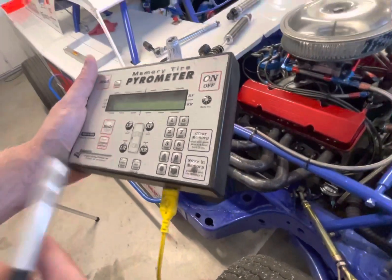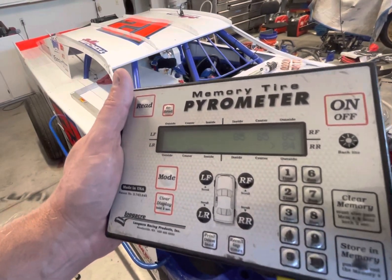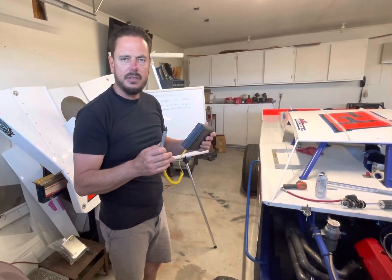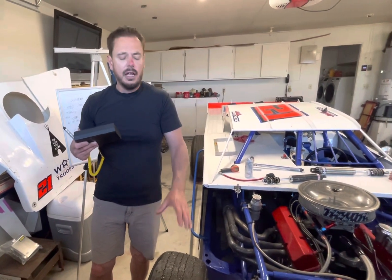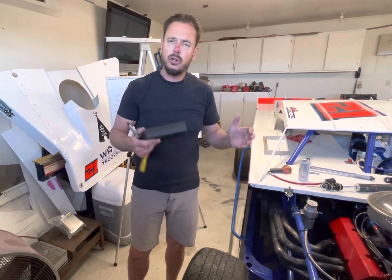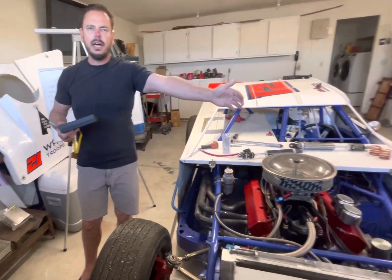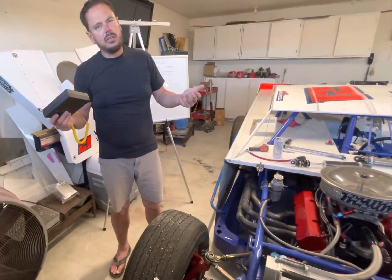This gauge has memory and is digital — you can save and clear readings. You don't need this nice of a gauge; you can use a cheaper digital gauge and have somebody write the numbers down. Always get in the habit of doing it the same way every time and having the same person take the temps at the same time. Always start with the right front, because it's the most crucial tire on the car. If you don't get the weight off the right front, it's going to screw up the rest of the corner — that's your turn-in. If you don't get your turn-in right, the rest of the corner is screwed. Then go right rear, left rear, and end at the left front. Whichever tire you do first is going to be the most accurate reading.